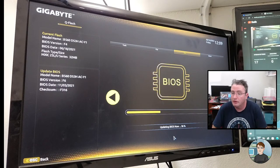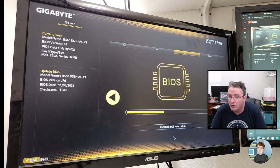Arnold Albert: I replaced a failing mechanical hard drive with Windows 8 with a 2.5 SSD loaded with Windows 10. While downloading and installing updates, I noticed the PC now becomes laggy. Moving the mouse takes time. YouTube videos are laggy. Interesting. I would look for driver updates and a BIOS update